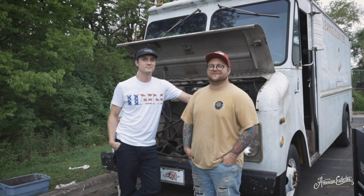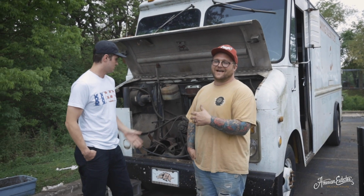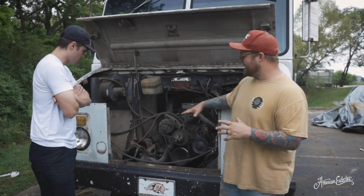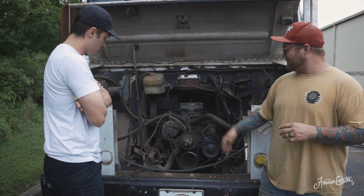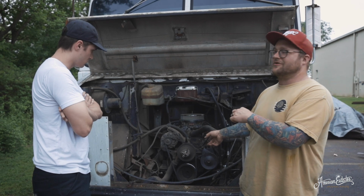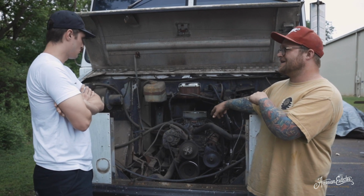What's up, y'all? It's day 2 here. Yesterday, you saw us cleaning this thing out. Boy, that was a mess. We got all of that out of there, got this thing ready to start digging into, and then we went ahead and finished the day out by taking the front end out of here. We got the grill and the cross members, the radiator and the fan shroud all out of there. So now we're going to work on pulling this power plant out of there, get that motor and transmission out. So I think the first thing we're going to do is take that carburetor off of there so it doesn't get smashed. Is that right, Harry?